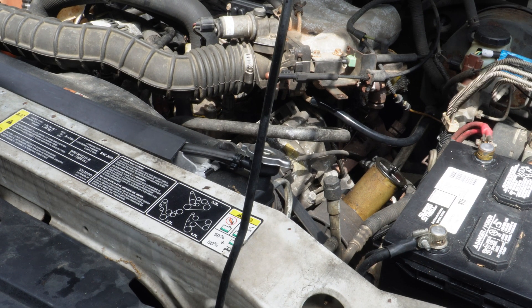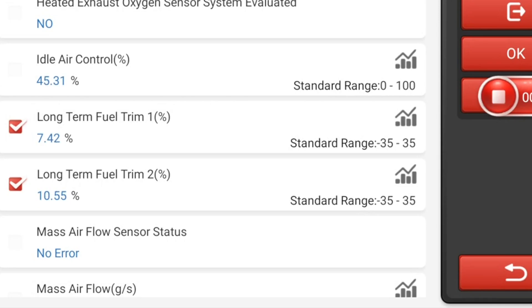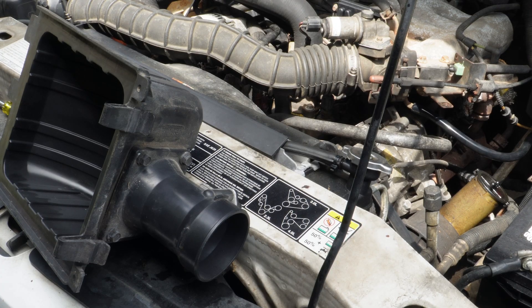So I just hooked up to my scan tool. My fuel trims — long-term fuel trims — are definitely going down. It takes a little while before they actually bottom out; everything's got to kind of relearn and do its thing. But it has definitely dropped, it's within the allowable 10%. There's no wonder with that massive vacuum leak. It's still a little bit of an erratic idle, but way better than what it was. Got the fuel trims down from that leak, but I still got something else going on. So when I dig into it further and do a little research, then I'll let you know what I did find. I want this idle smooth as still. I haven't tuned this car up yet — it could just need some plugs and plug wires. Keep in mind this thing's sat up for four years, so that's saying it needs it anyway. And that could just be the last little piece to this puzzle here, but definitely made some improvements.